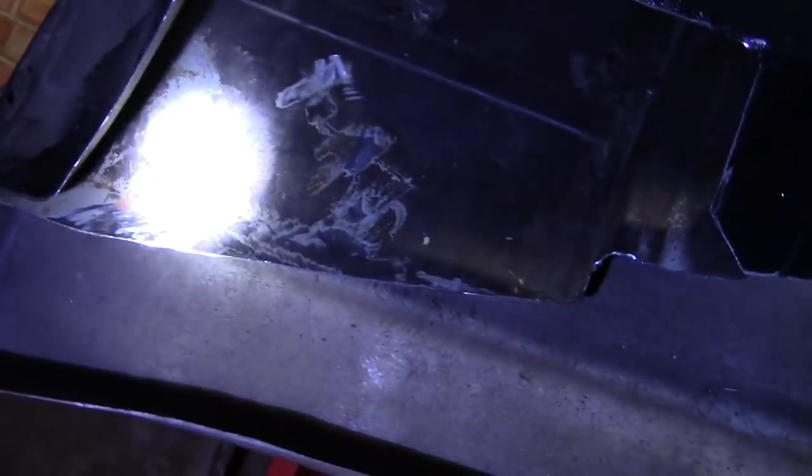Stand by. Okay, that escalated pretty quickly. I took that panel off there, but what I found was I still couldn't really maintain what was in there. So I took a few more strips off, and what we've got looks a little bit more sensible and maintainable now. So that's what we've got now. Most of the rot's been cut off, and I can actually get to it now, so I should be able to stop it going much further. So what we're going to do now is clean it up, paint it, treat that, and that will be the new corner of the car.